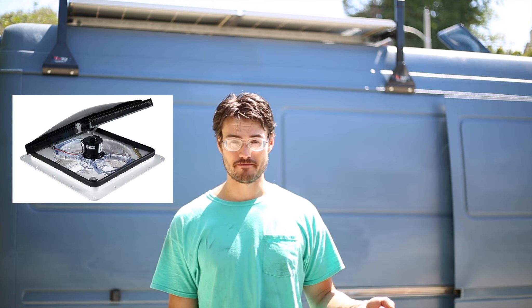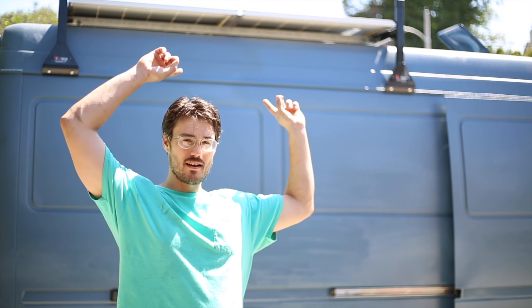So we're going to add another fan. We're going to take the panels up top and slide them forward, just loosening up the bolts on the roof rack which are attached to the rain gutter. Those bolts are going to be loosened and we're just going to try to slide the whole mounting apparatus forward. It's a little over a hundred pounds so it'll be a little difficult, but it should slide forward and give us enough room in the back to mount another fan.